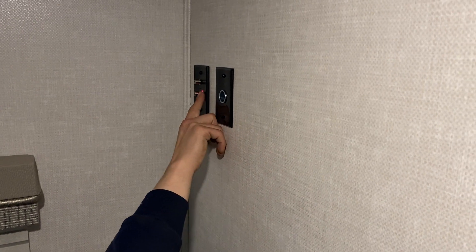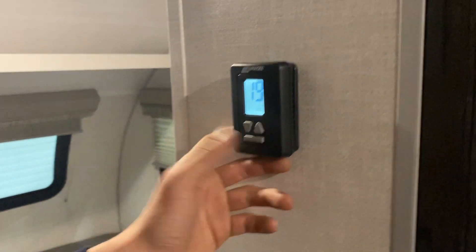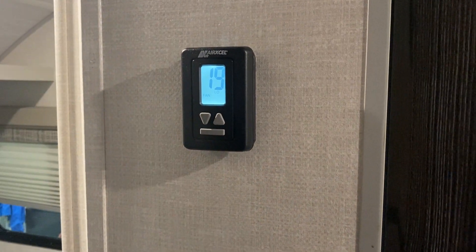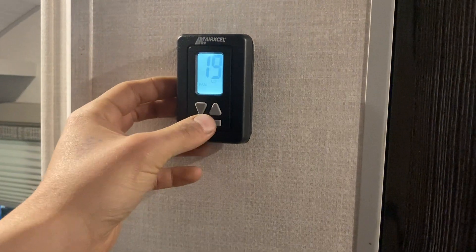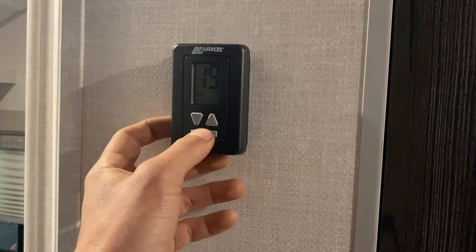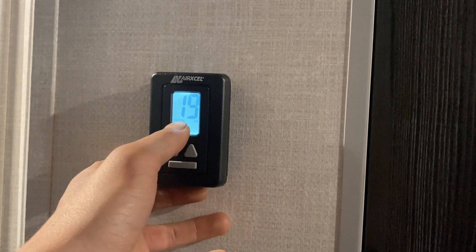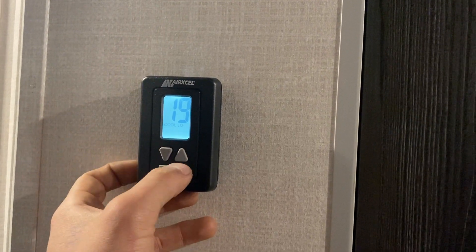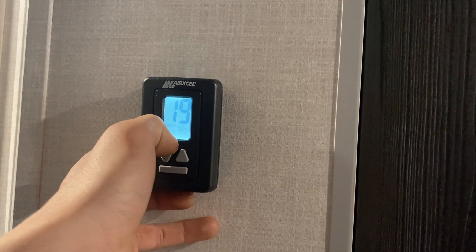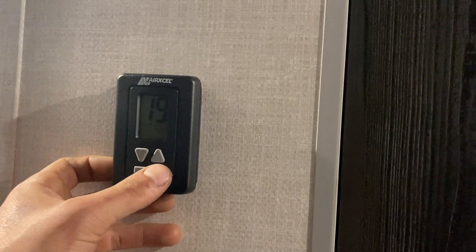That antenna button will also improve your stereo signal. For the thermostat, press the bottom bar to wake it up. Starting from off it'll go into fan speed — fan on low just moves air at low speed. Next is fan high, again just moving air. Hit it again for cool on high: the high fan runs all the time, using the cooling in and out as needed. On cool low with auto, it'll cycle the fan in and out as needed rather than running it constantly.